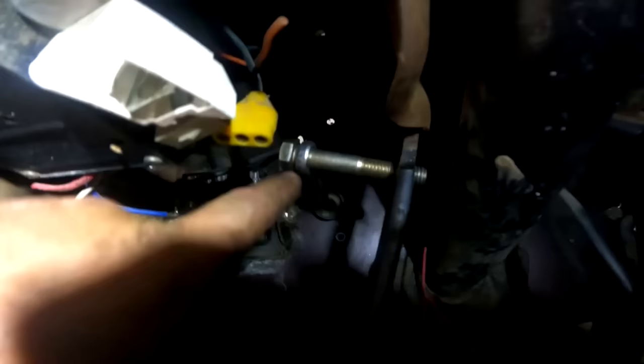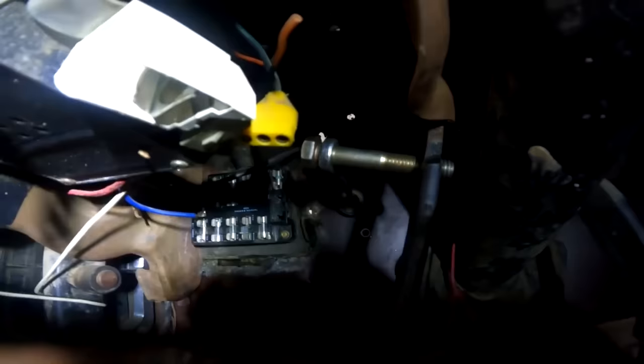And what I'm gonna do is just drill a tiny hole probably in the back of this shackle here, wherever the eyelet is, and then just put a needle greaser in it. You can just fire some grease in there now and then whenever you grease the truck, and I think that'd be better than good. Look at that.